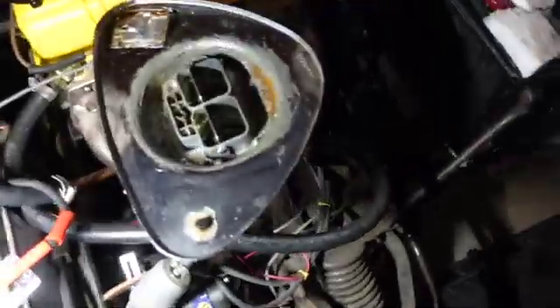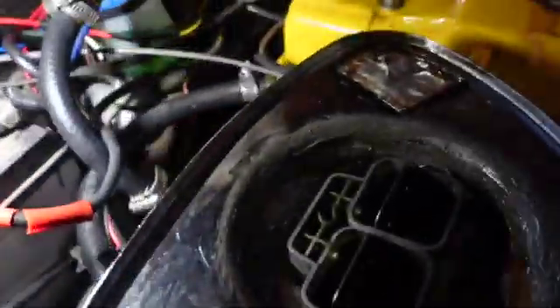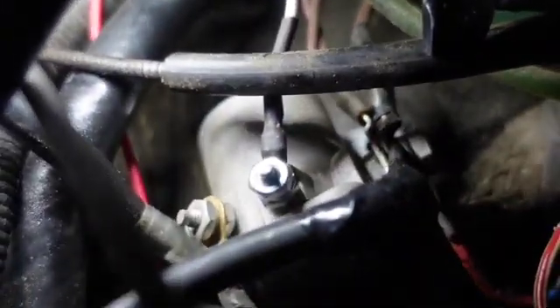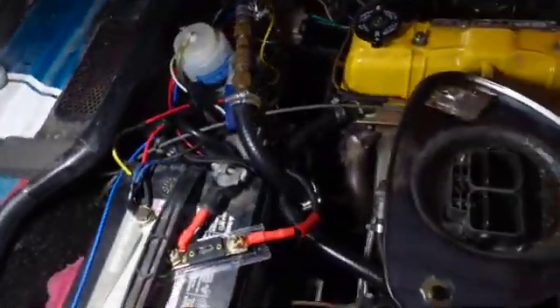Crazy fuel pumps and stuff. I think I've got to change — this is a two-barrel Weber synchronized, see the gears? I think the accelerator pump's bad in it again. They go bad every couple of years, it's kind of annoying. So there's the wire — see the white wire there going down to the R-terminal, and it goes down and around and comes up here on the negative side of the new coil.